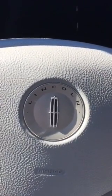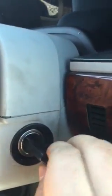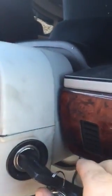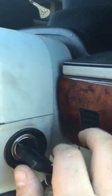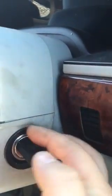First thing you do, you get in the car and make sure that the door locks are unlocked — all the doors. Next thing, you take the key and put it in the off position, the position where you could just pull it out. Without pressing the brake or anything like that, you turn it on to the on position and back to the off — you do that seven times.